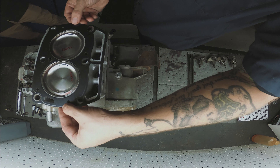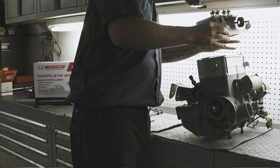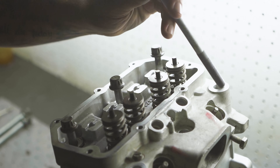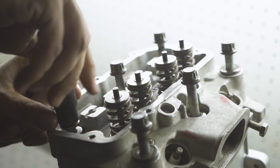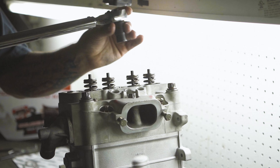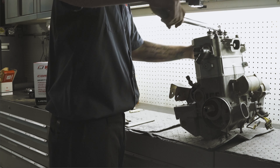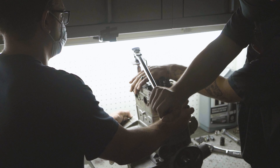Apply your head gasket. Making sure all your surfaces are clean, go ahead and install the cylinder head. It's always good practice to hand-thread in the head bolts first, since the case threads are aluminum. Following the Polaris OEM manual, torque the cylinder head down in the correct order and to the correct torque spec. Use your torque angle tool to then achieve the recommended torque angle degree for each head bolt.